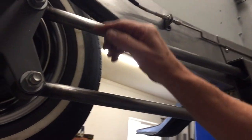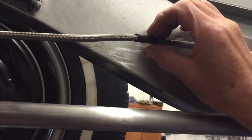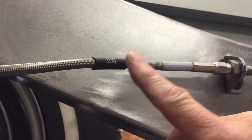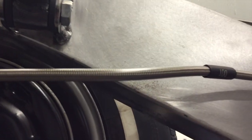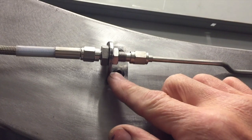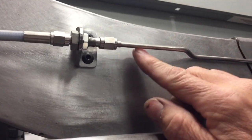This little tab here is just welded onto the axle housing, and then there's a piece of flex line here. I didn't know this before but there's actually DOT-approved flex line and competition flex line. I don't like to take chances on brakes, so I went DOT-approved — and it's the same price, so it's worth it. It has a vinyl covering on it, which is pretty nice. Anytime you go from flex line to a hard line you're going to need a tab with a bulkhead fitting — the nut here tightens it onto the tab.